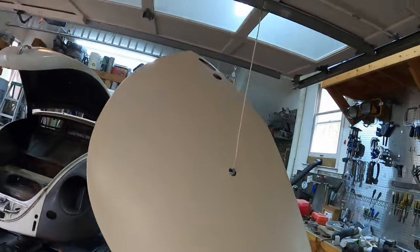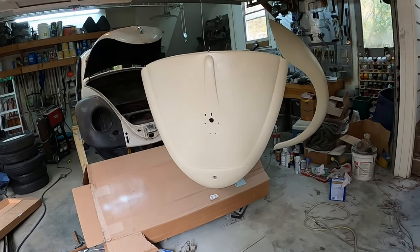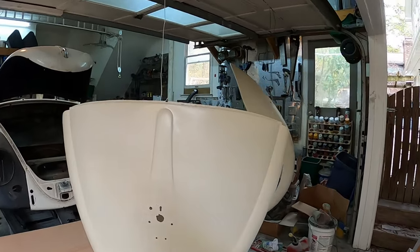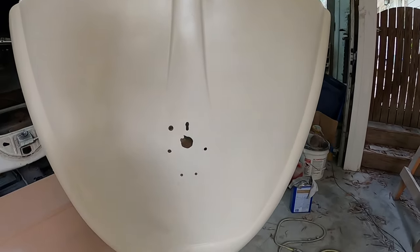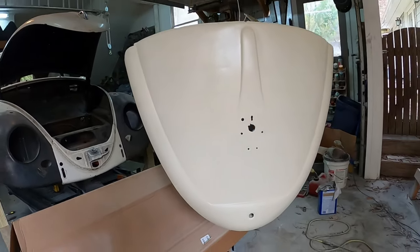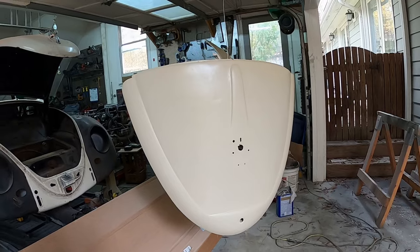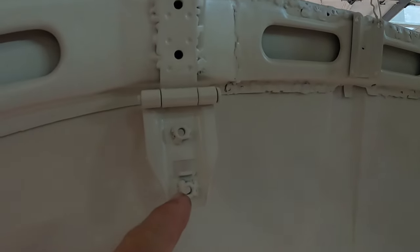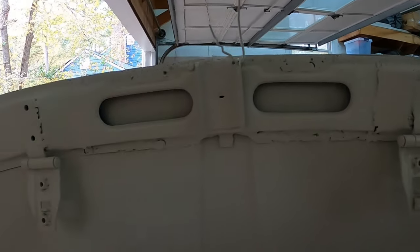Overall I think these two pieces look great. Upstairs I have the other back fender already painted. The idea is that as I'm doing the chassis and body work on the car, I'm going to take all of these component pieces, do them, then put them upstairs on the ping pong table and whisk them out of the way. I'm pretty happy with this deck lid given the condition it was in before I started — I think it's going to be totally usable. I welded on some bolts on the reverse side because the threads were bad here and here. It's a little ugly but it works.